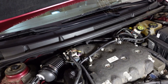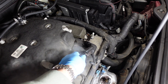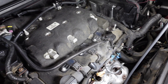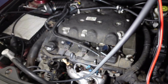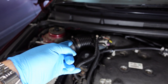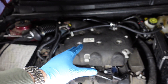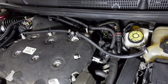Because I was most concerned about this hose running from here all the way to here, let me undo this and see the smoke actually coming out of the end. Yep — look at that. So I was blowing smoke through the system and it was not coming out of that hose, which is the one I thought might have had a leak. I'm pretty impressed. I may need to get under the car to check, but if there was smoke it would have been lifting up, and I didn't see any. Vacuum leaks would show up around the throttle body, intake manifold, or somewhere in that area, but I didn't see a wisp of smoke anywhere.